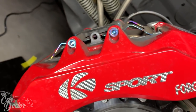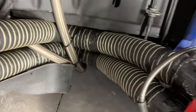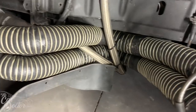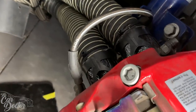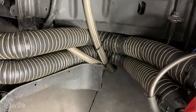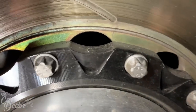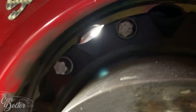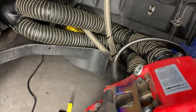That's how we're gonna get all the cooling to these big brakes — I think these are eight-pot big brake kits. The flow is looking nice and even for both of them. We actually put a little bit of air pressure with the air gun through the outside and tested it, and we were getting air pressure at the brakes — that's just with a regular compressor, so imagine at high speed. Since these are two-piece rotors you can actually see through them — watch, there's the light coming from the back, right through there. That's where the air is gonna come through to cool these brakes.